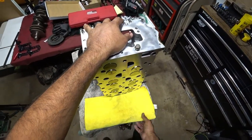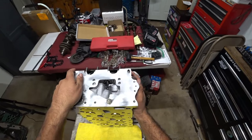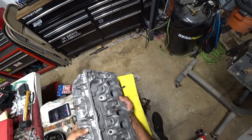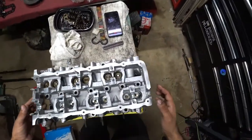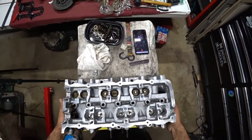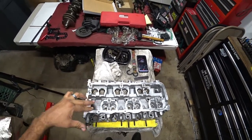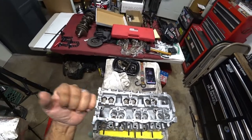What I'm going to do here is get my rag nice and double-folded, lay this down, and try to seat everything as nicely as I can. Now, if I see how the valves are going to go up and down, this is why we put the wood on here — so when we get this ready to be tightened down with a strap, we'll be able to make sure all valves have full tension. We want to prevent the valves going down while we're pushing the springs down to put our keepers in.